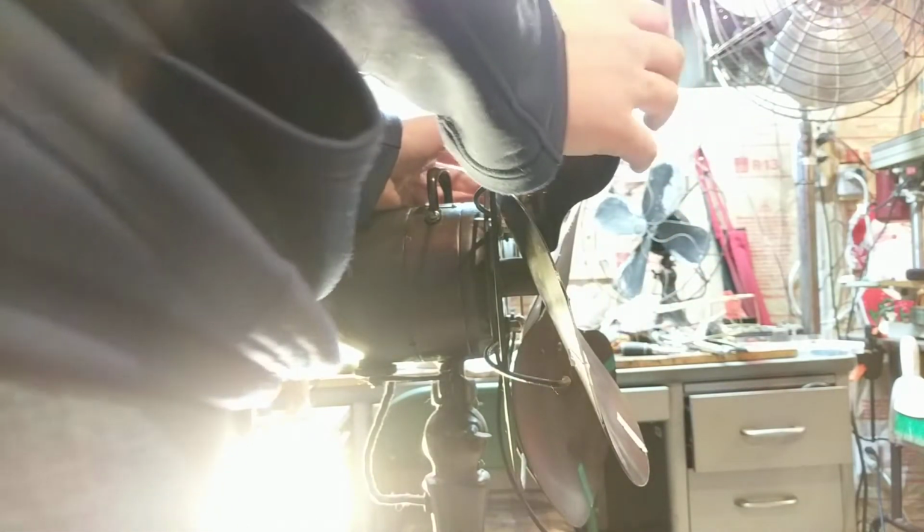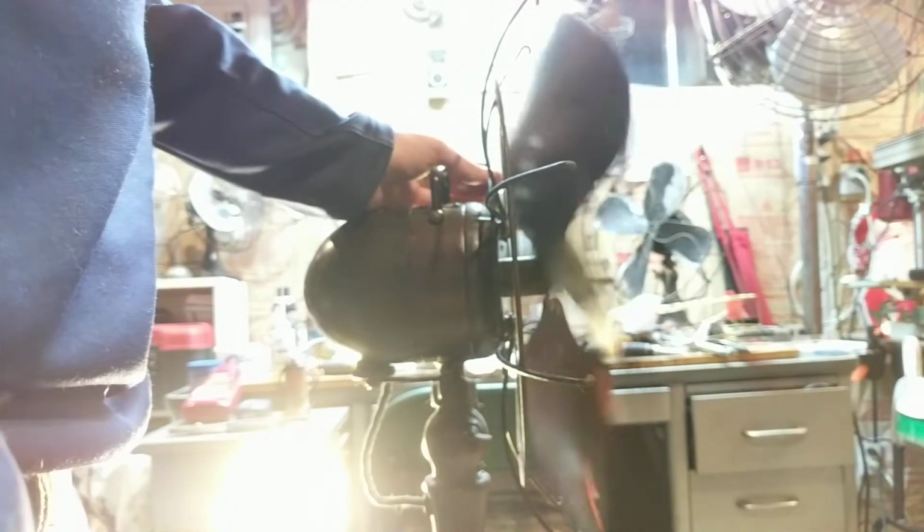Now the front, what you'll want to do is get the cage on, and you'll bend more. Bend at the spider until you get it. Once you get these aligned, you can start bending on the blade. And don't bend it a lot. Then you'll just take your finger, check all up here, and once you get the front blade on, you can see which is pushed forward. And this one won't be balanced because it's got a clock issue, but the pitch is really easy.